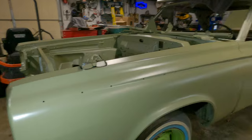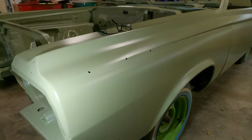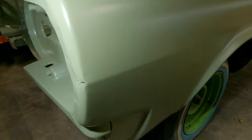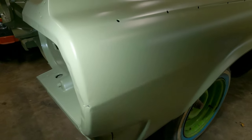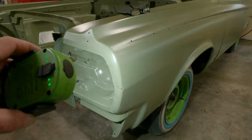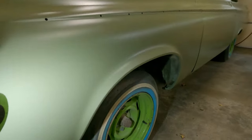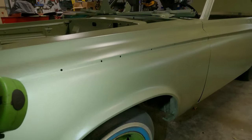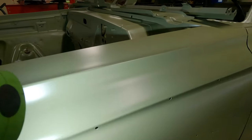But what needs to happen is there's numerous dents and dings in this thing. Somebody in the day tried pulling this out right here. Clearly there's two holes. They bonded it up okay. I think it'd be best if I got my license plate bezel and held it in there. All along the car, I'm going to go around with my marker and mark what might be dented.